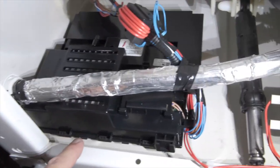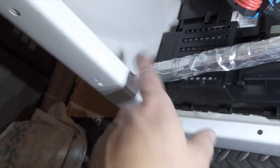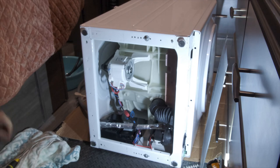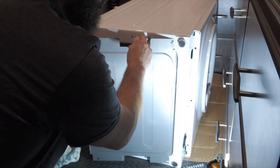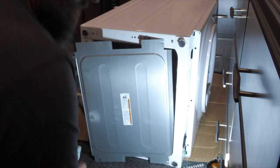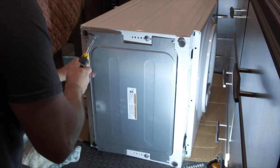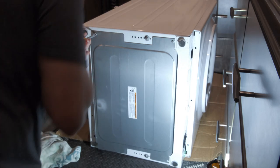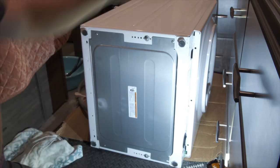I got it all screwed back in, back in place, with the cover back on and all the wires taped up nicely. You want to make sure you tape up the wires really well so everything is tight, because this is moving around a lot in here and there are a lot of sharp edges — if a wire gets loose and catches on anything, you can cause yourself a bunch of problems. They recommend taping the harness to the drain hose, which I did. I also taped the drain hose for extra security. It's always a good idea to take pictures before taking things apart.